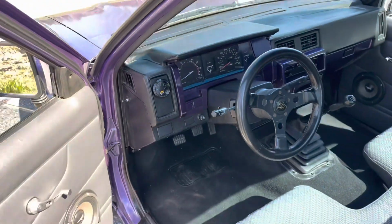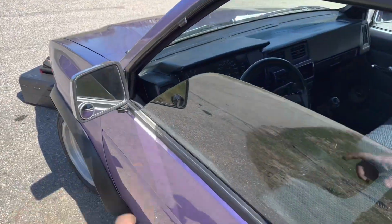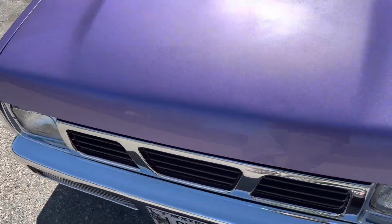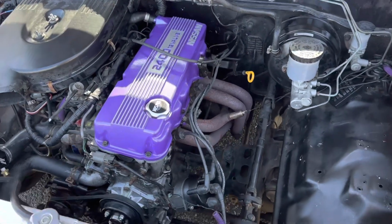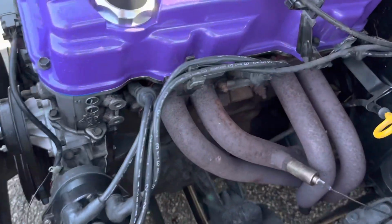I had some issues with it before. We did try to change the little clutch safety switch because I figured that might have been going bad. But if we're having the same issue and that's all bypassed, then there it is. It means it's a starter. So until then, because the truck is kicking over, we are going to change our spark plugs.